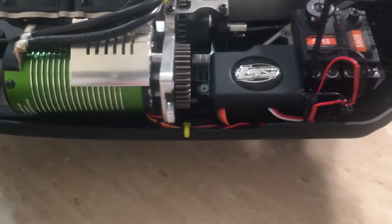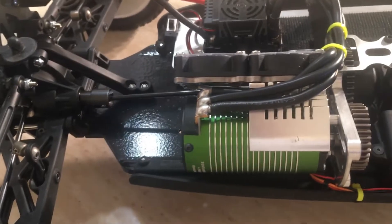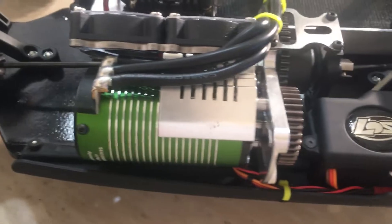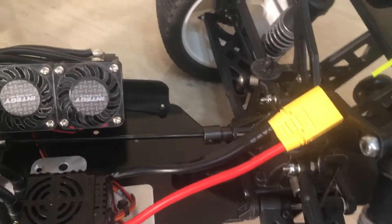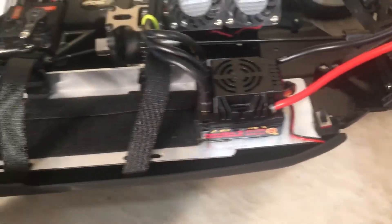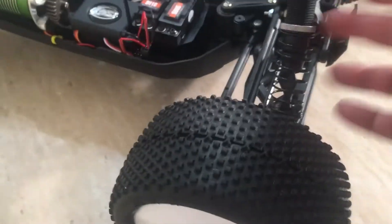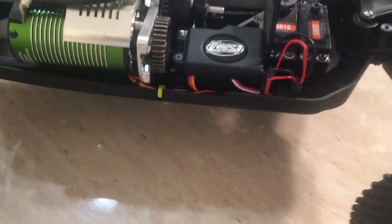You just have to be ingenuitive and think of these things and find out how to make it work. That's what I do — that's what I love about these builds, finding out how to make different things work. I'm running the 2200 KV Castle motor with the NTG double fans, 40 millimeter fans. I'm not doing speed runs on all my cars — I got enough cars for speed runs. I just like to bash these around outside, on the grass, at the park, in the streets. I also thickened up the shock oil because the springs are terrible — put 80 weight in there.